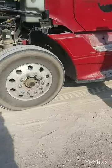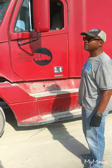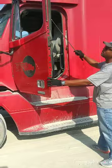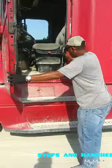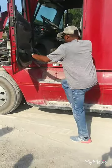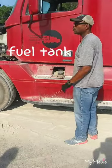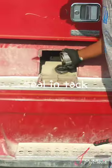Then come to the door. My door hinge and my mirror should be properly mounted secure, not cracked, damaged, or broken, and the door opens and closes. My weatherstrip should be intact. My steps and my handhold are properly mounted secure, not cracked, damaged, or broken — there's no debris on the steps, and it should be able to hold my weight. Then my fuel tank should be properly mounted secure, not cracked, damaged, or leaking. The seal should be intact, and there should be fuel in it.